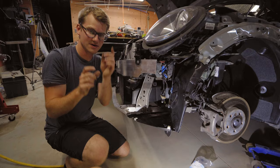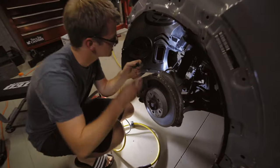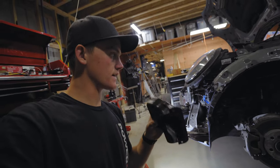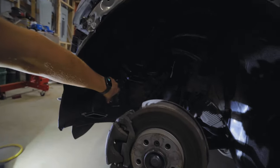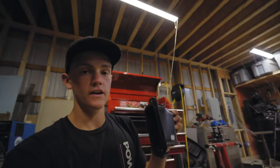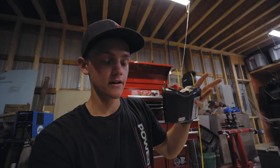There are plastic rivets like we showed on the other side that will go on the other end of that. We decided that these holes are too small for the plastic rivet — the holes in the liner are the correct size but these holes are smaller. So I figured, make it easy: drill these out to the same size as those, use the plastic rivets, done.